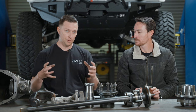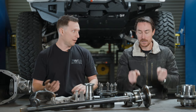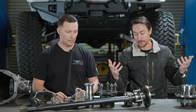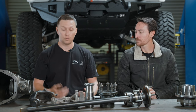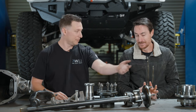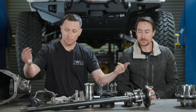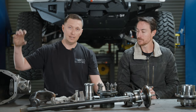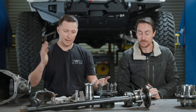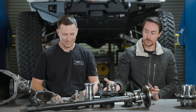On a full-float design — what comes on three-quarter-ton and up trucks — the weight of the vehicle is carried by the housing and the shaft inside of it floats, only seeing torsional load. The weight of the vehicle is carried on a spindle that presses and welds into the housing. So it's weight on the housing and torsion only on the shaft. That end play in a semi-float makes the bearing a pivot point, meaning the differential end of the shaft is actually a structural component keeping your wheel straight — if it breaks, the wheel just flops over.